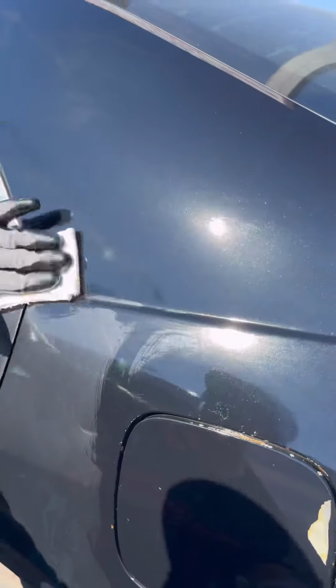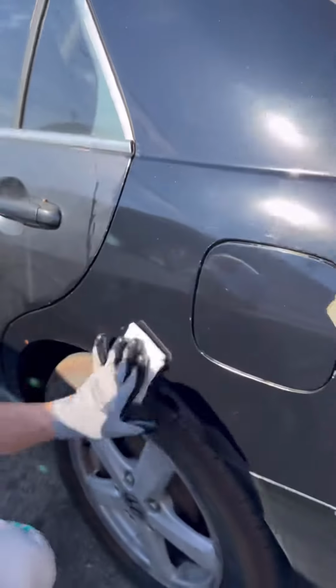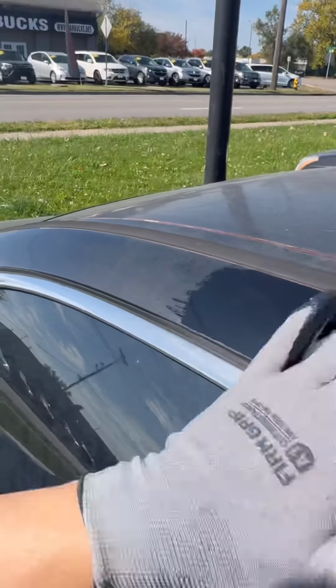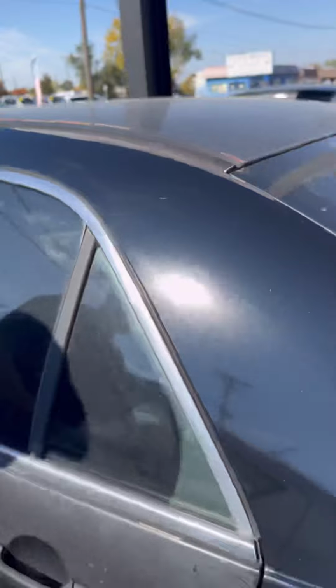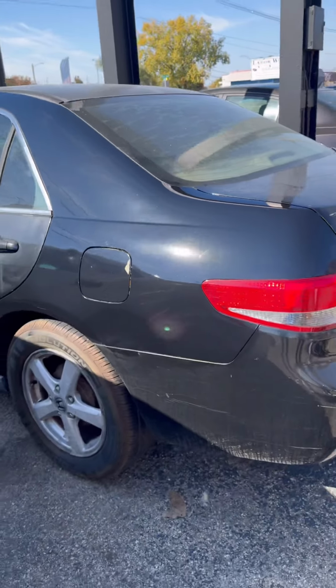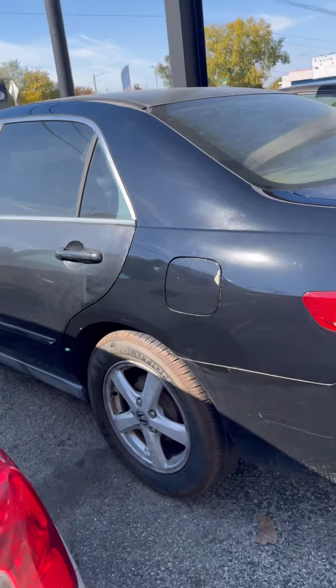We get a lot of one-star reviews because people don't clean the panels, they don't apply the product correctly. This is a watch what you're doing and apply it evenly on a completely clean surface, and you will be golden. The two cardinal sins when applying Shiny Car Stuff are applying to a dirty panel, which will yield hazy, foggy results from the dirt, and getting it wet before it's cured. So do not get this coating wet before it is cured. It will be a hazy mess. So plan accordingly if your car needs to be outside.